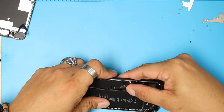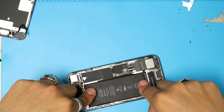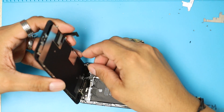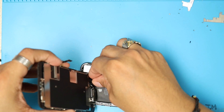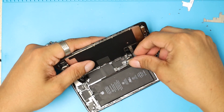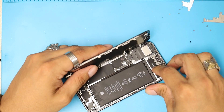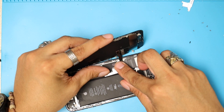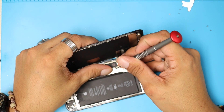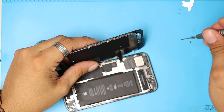Of course, you're going to unplug that battery first. Make sure it fits and it's not crooked. Then I'm going to connect this screen — we're going to connect all the cables back into the motherboard, starting from the one on top. That's how it's easier to do. Connect the one on top for the front camera, and second, the one on the bottom. Connect the battery flex cable, and we are going to put everything back together. Remember, don't confuse the screws because there are different sizes.